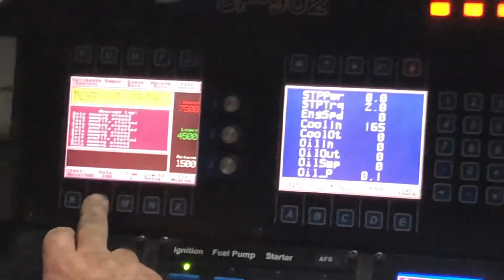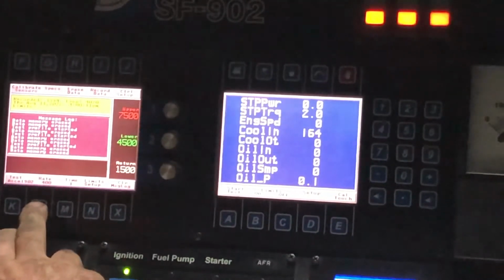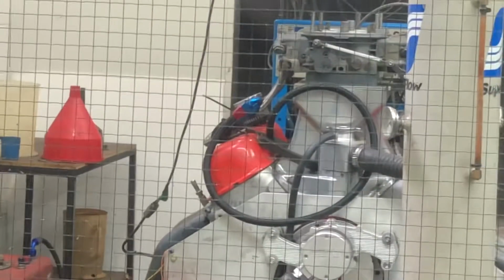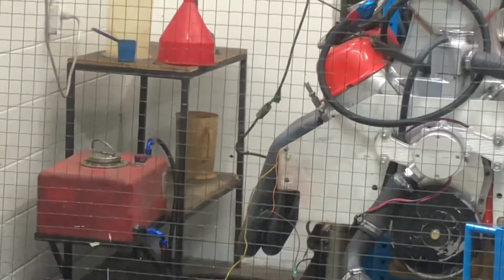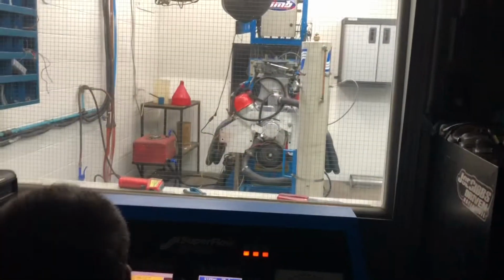I made it 200 RPM per second. Maybe we're going to do 250, three, four. Four is good. Let's try four. And then it'll be a little bit more like it's pulling a gear at the track. It might change something a hair. All right, well, let's get out there with our timing light. Technically, four gears. Oh yeah, the RPM is changing way quicker. We're not land speed record racing it for sure. Well, does this change the sound at idle at all?